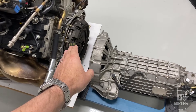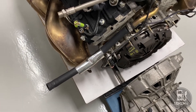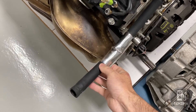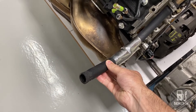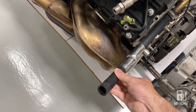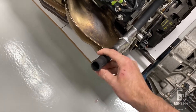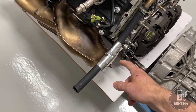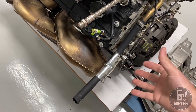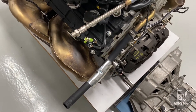The transmission would be connected. The culprit is this hose over here. As you can see, it's a standard coolant hose, but the problem is that the hose runs very, very close to the exhaust. This is the actual path that the hose takes — it runs really close to the super hot exhaust manifold. The only thing Lamborghini has given you is this thin little bit of covering over just a standard coolant hose. What happens is this hose will be superheated over time, it degrades the rubber, and with enough heat on a given drive, the hose will burst — almost always right around the area where most of the heat is.